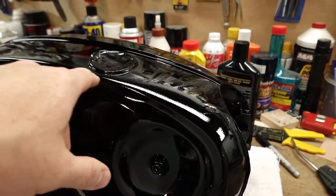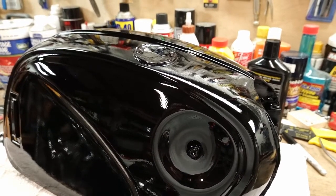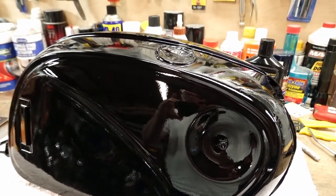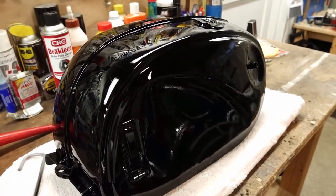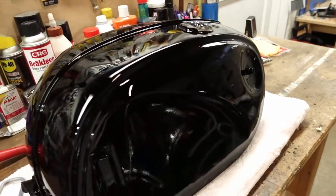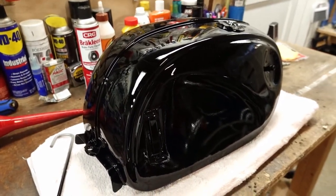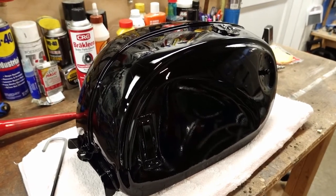the kind of dry looking areas smooth, and then I'll kind of scuff that up, and I'm going to lay probably at least one heavy coat, maybe two. I'm going to do the other coats with it in this position. That way I can get a better angle of the whole top side of the tank and hopefully make more even passes. So hopefully that'll also help improve things. So I'll just set it on a sawhorse or something similar.